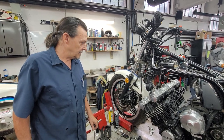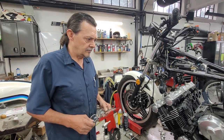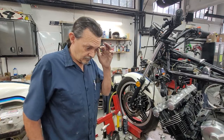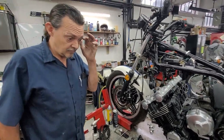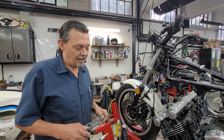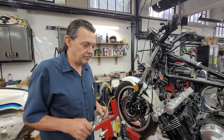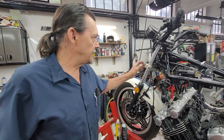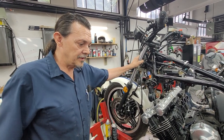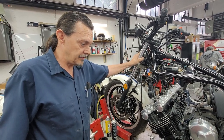So I had to take them apart. In your opinion, tell us your thoughts about ethanol fuel versus the VP small engine. I've been using the Shell V-Power fuel — it's 93 and it's enriched with nitrogen. You can run that in your bike all year long with no issues. But you don't want to store your bike with a fuel like that or VP110 and have the O-rings shrink.